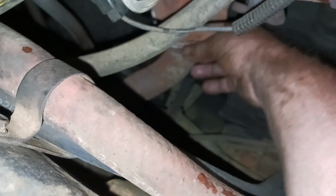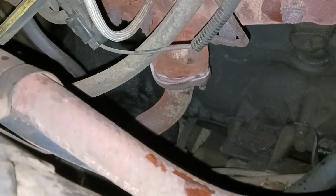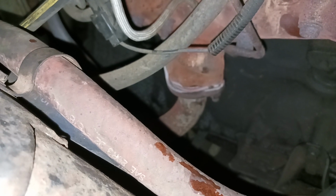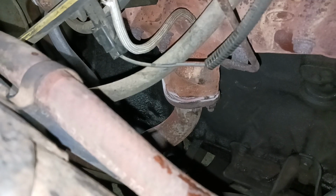Oh, we're going to look at this before going any farther, really fast. I'm going to grab those real quick before we go any further and get this hot. Ooh, that's kind of scary. Wonder if we can slide a gasket underneath that. If I can't, I can't. I'm not going to worry about it, but to quiet down the exhaust, because I can't get the donut. There's no donut gasket. It's gone. And once you undo that, you know you're going to break both bolts. So I'm just questioning if I can slide a regular gasket inside that, and maybe just run a little hose clamp around it.